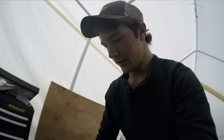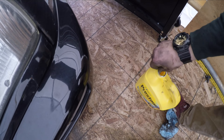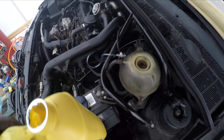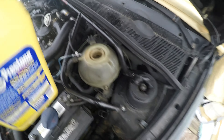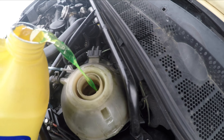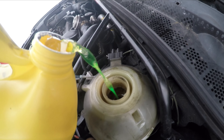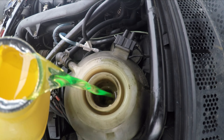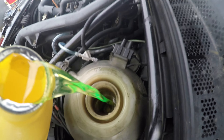I'm going to add some coolant right now, because when you take your EGR cooler off you lose a lot of coolant. I'll film that and then do a first startup. Alright, I'm going to spill this terribly with one hand — oh, not too bad. It is quite empty right now. Alright, I'm going to put this down, fill this up, and then I will start it.